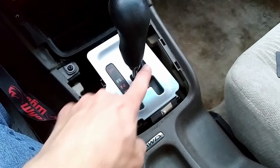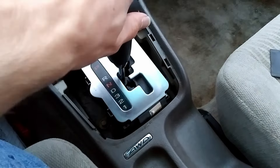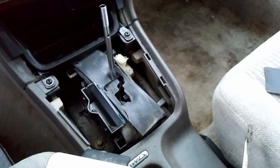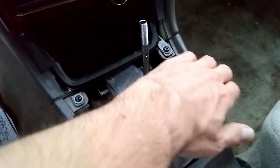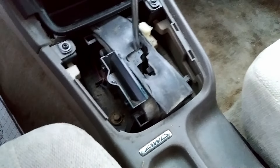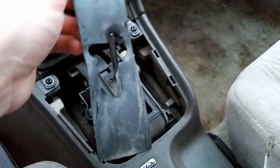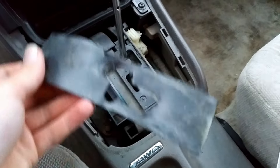Now it's just the shifter and the fascia thing. The shift knob just unscrews — it's a long thread and I think there might be a lock nut in there, but yeah, it just unscrews. I didn't even need a flathead screwdriver to pop that fascia off; I just tugged on the passenger side and I was surprised when it leapt right off. As you can see, that's what's left of the original shift ribbon. There is not a lot left — there's a bit of a shift pattern. Hope nothing's down in there and jammed up, but there's the old shift ribbon.